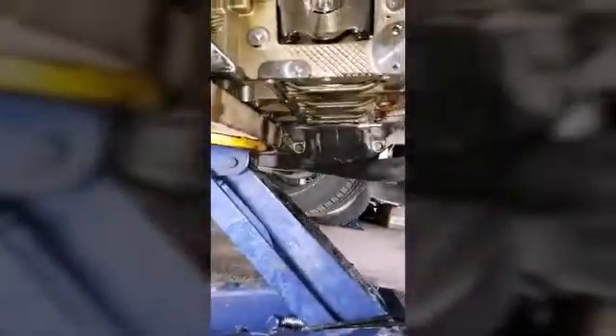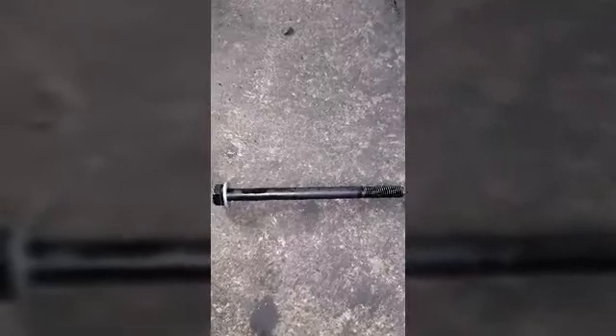All the timing is off now. Took the valve cover off as well, took the oil pump off. Now you're going to have to run to a hardware store. This bolt is 100mm or 110mm - it's 125mm, M8 thread pitch. This is going to be used to plug the fourth hole right here because that will leak oil. So you're going to plug this off, put some Loctite on it and plug it off. Then you're just going to put on your other oil pump after priming it - priming it is as simple as just putting oil in it and spinning it. So pour some oil down into the ports, spin it around, get some oil going in there, and then bolt it up.